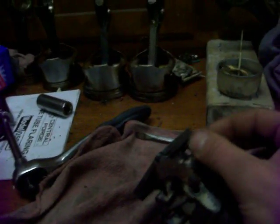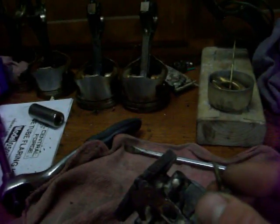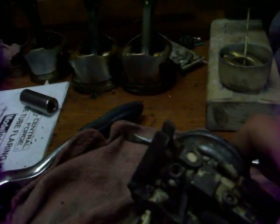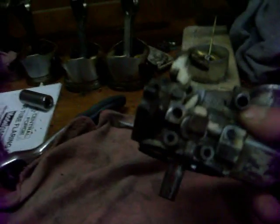This one's still in good shape. I've looked at this and there's nothing wrong with it. What you look for in something like this is if somebody screwed this in too far and marred up that head. And if that happened, basically you'd have to buy a new carburetor, because that's not a screw-in jet — it's actually just a hole in the carburetor body itself. I've seen people do that where they just crank them in.